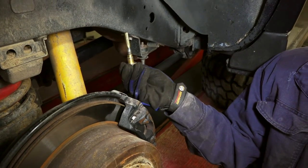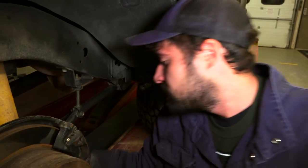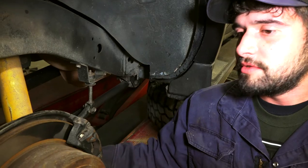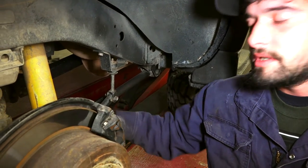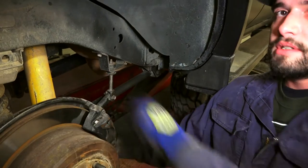On reassembly, you always grease these pins up with disc brake grease, which handles heat a little bit better, preventing them from seizing. Those times you hit the brakes and the brakes lock up — it's because of those pins locking up most of the time, or more wear on one side compared to the other.